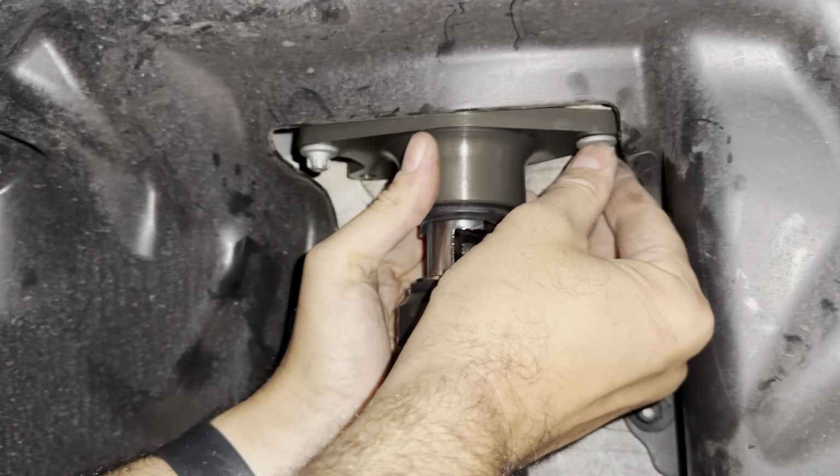Okay, so where are we at here? That is, how about that? That's 13 mil, so I'll get it to snug up on just below the ring. Wind it in. How are we doing on the spring tension? Maybe I'll loosen that off a bit too. Okay, spring is almost as short as it can go. It's loose. I've taken another just over 10 millimeters out of there.